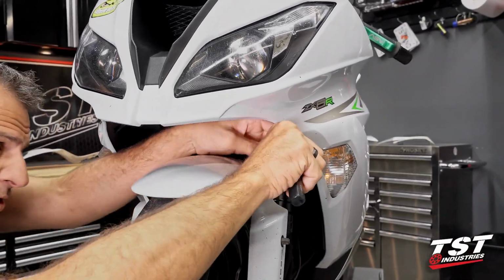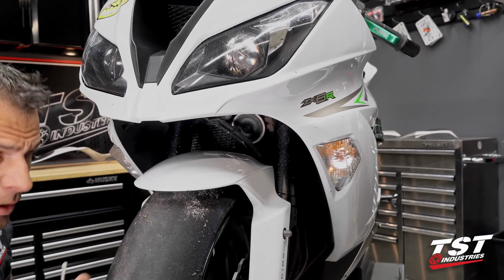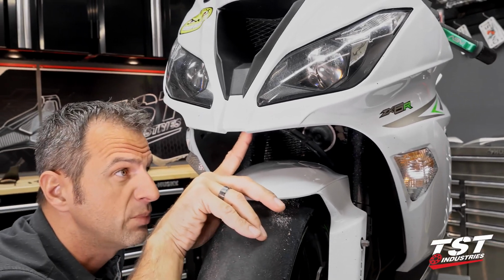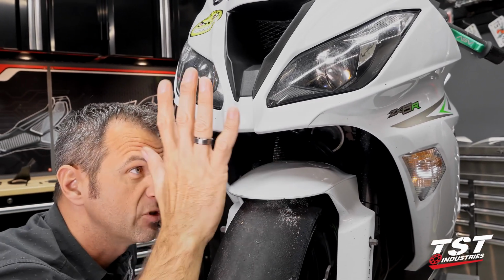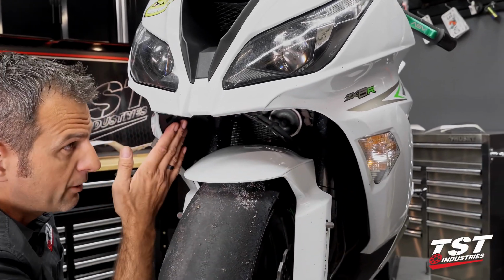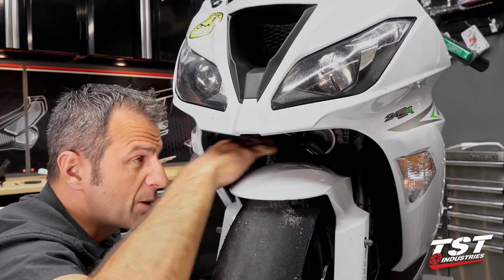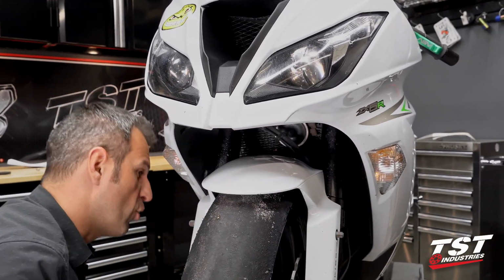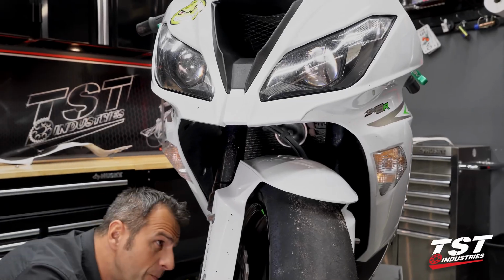On some of these locations, I won't be able to show you in detail, but basically you guide yourself with one in the front here being the one that joins the 2 panels into the nose, and then there are 4 more on each panel. These come as 2 separate panels here in the scoop. You have 4. Once you extract 4 from each panel, you're good to go.